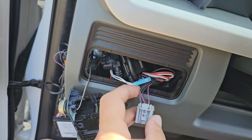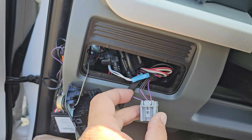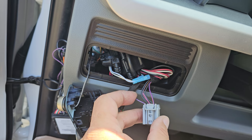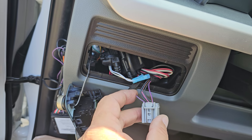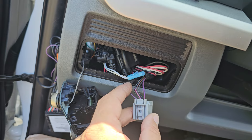If you've got the clip looking at you, the middle wire right here — it's a purple with a red stripe — that's constant. The one right next to it, purple with white, that's ignition. It does have about a 15 or 20 second delay, but it's 12 volts and it goes to ground, so you no longer have to go to the key panel — you can just go right here.